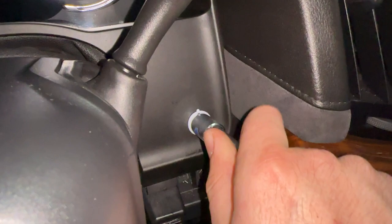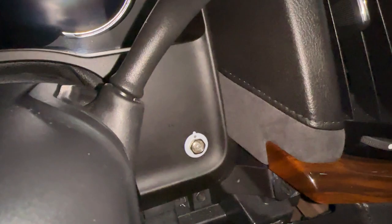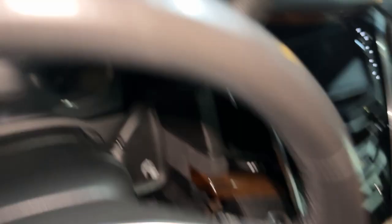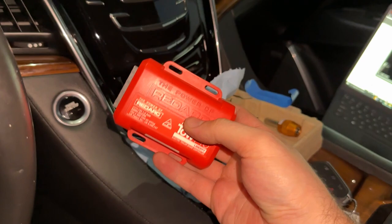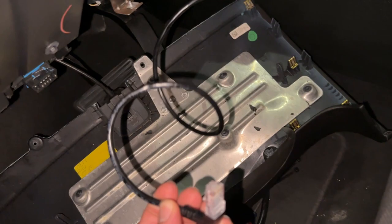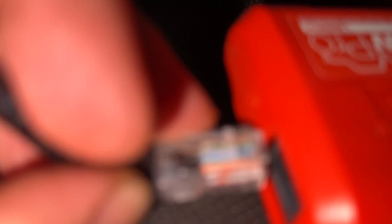I had to enlarge the holes just a little bit because the LED backer plate has to pop into that top hole and needs to be aligned, so I went up one drill bit size from an eighth and three-eighths. We're pretty much good - it's snug enough. Now let's get the button on. Once it's in, you spin it all the way counterclockwise and press the knob on in the zero position, then you can see it'll go up to ten and back down to zero. Now let's move down below and get the module itself wired in.